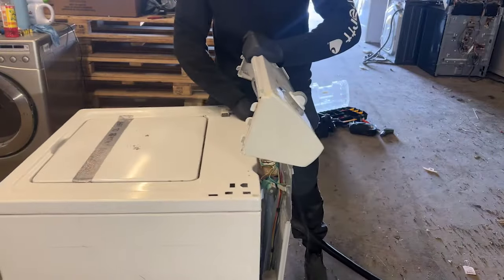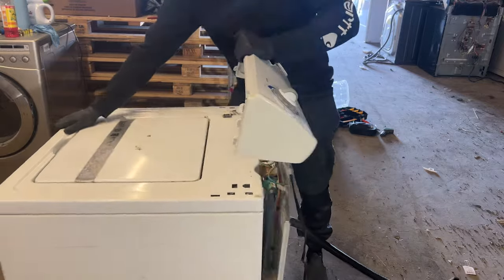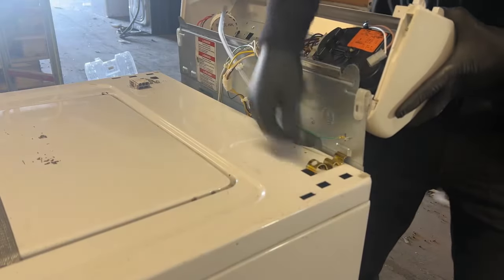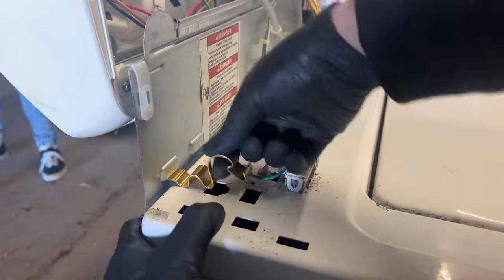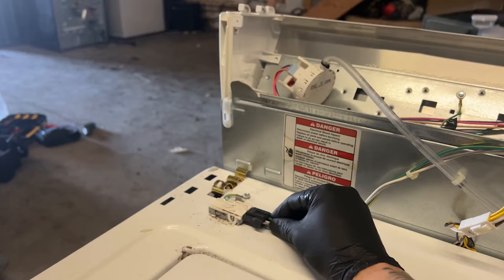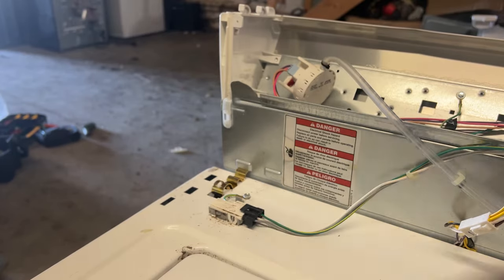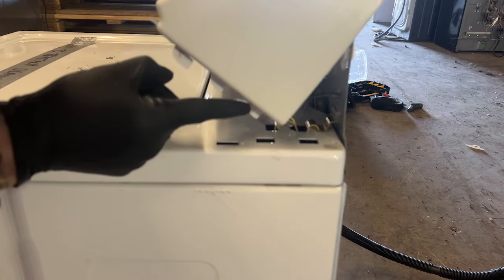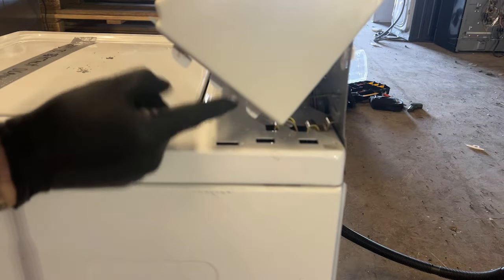The key is to make sure that the water dispenser sits under the appliance chassis and that the back of the appliance and the chassis almost sit flush together. Then reattach these gold clips using a little bit of force to push them all the way down. Once done, connect the door switch wire housing back to the appliance and fold the control panel back down, making sure these clips fit in the proper grooves.